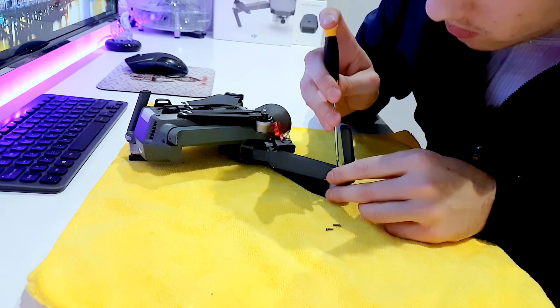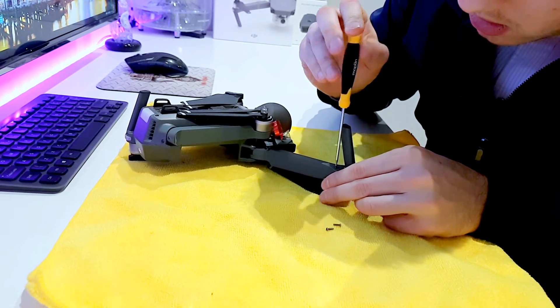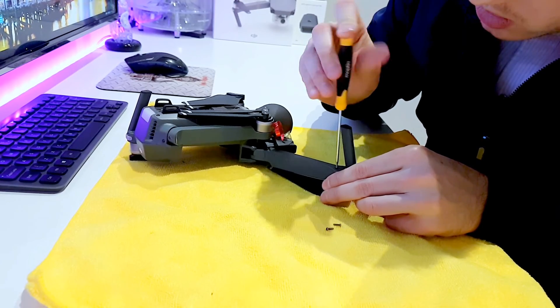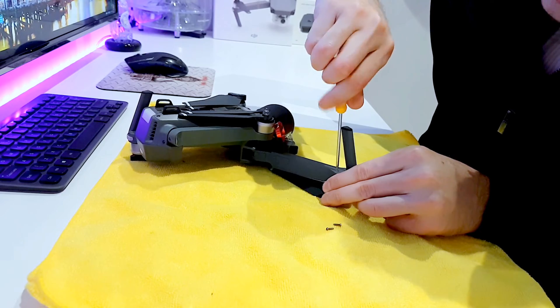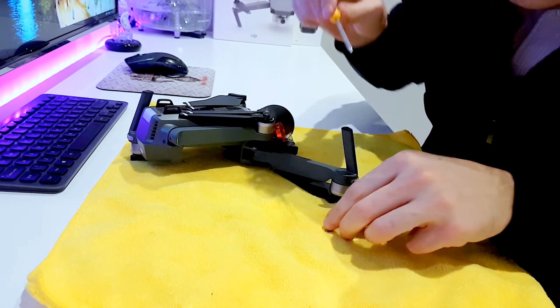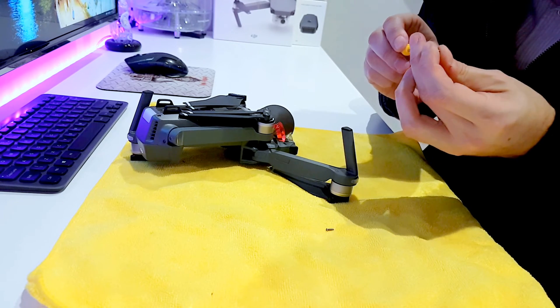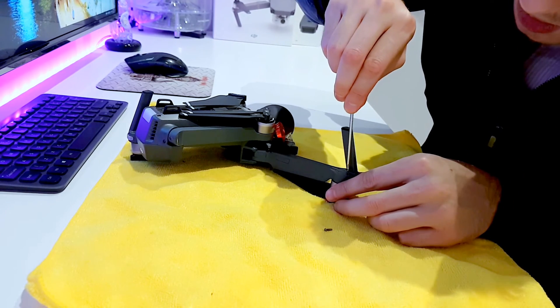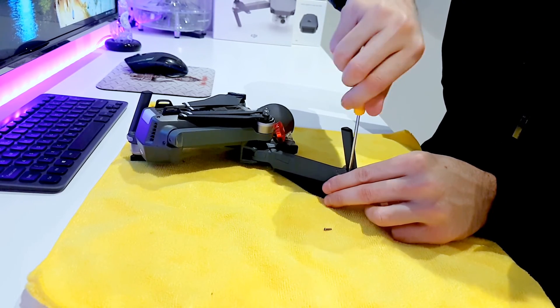Push the leg back into place and make sure it's neatly in there. Then go about screwing it back in — same thing: pull up on the motor and apply a nice amount of pressure into the screw. Do not round these off but do get them tight, because finding replacements for these screws would be very difficult.